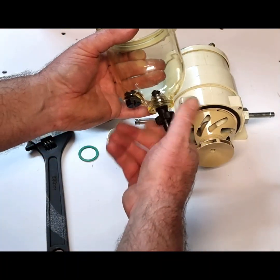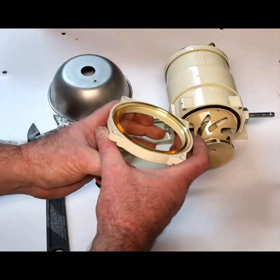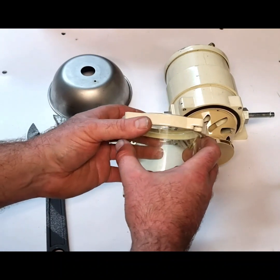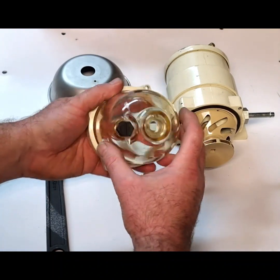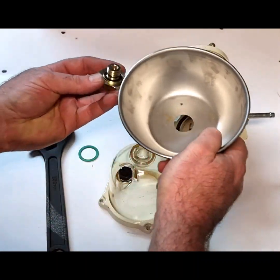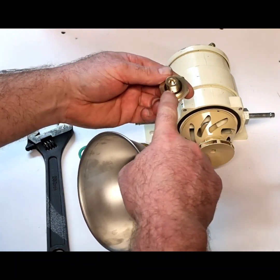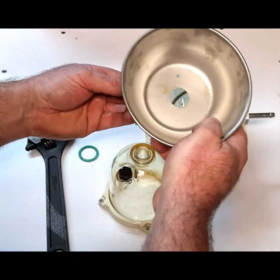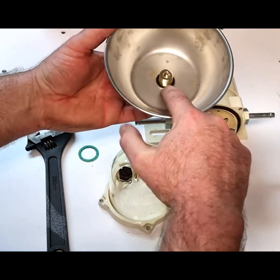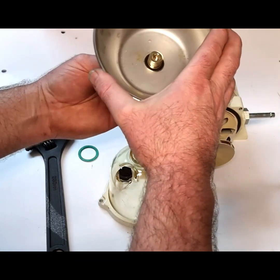If you don't remove it you can't remove this piece, which you do need to. Make sure that you leave this part on because you won't be able to get it on afterwards. Make sure the rubber seal is in its little groove and then insert that through there — there's a little journal that it locates on, so make sure it does actually locate.